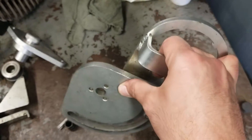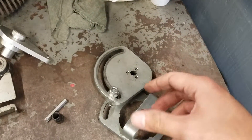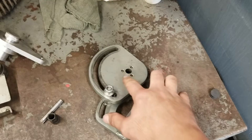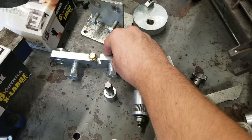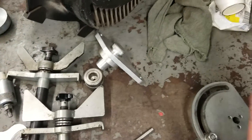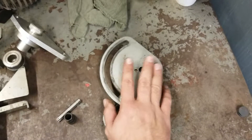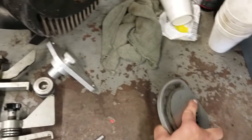This tool is used to lock the camshaft pulleys in place while removing the bolts. You cannot use the positioner tool as a lock tool — otherwise you will break the end of the camshaft. This tool locks both pulleys together.